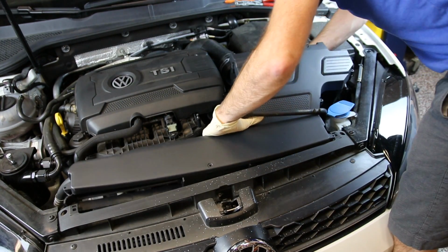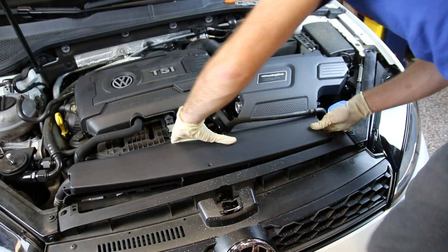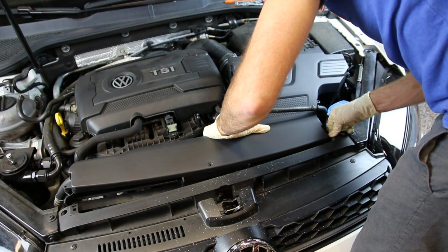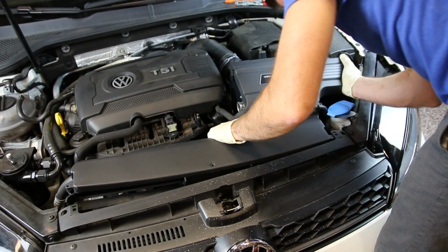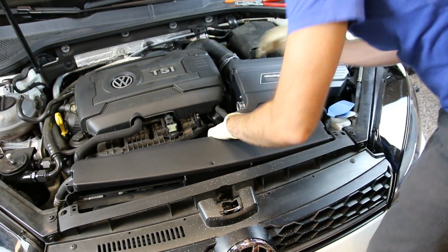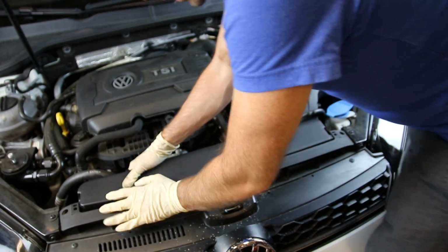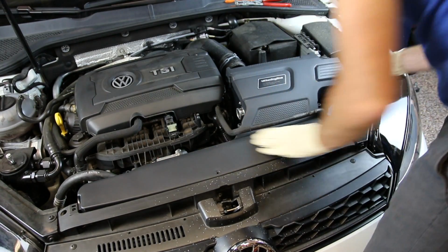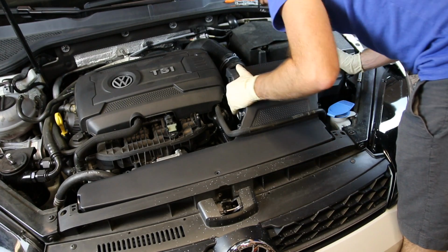And you kind of have to get it popped down like that, and then you can push this towards the side, and then the whole intake will shift over there. Once you get that done, obviously now you have to get this side in place and then pulled forward. Now we have that already mounted in place, and we can pop the grommets that are on the bottom of this intake to the place where they belong.